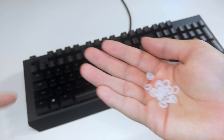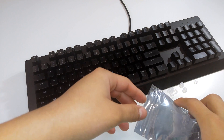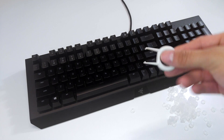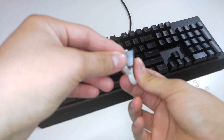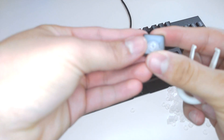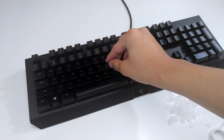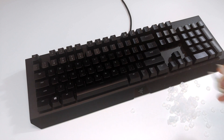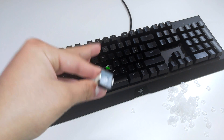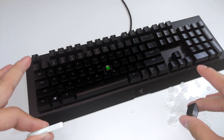These are the clear O-rings — very tiny and easy to work with. Since they're clear, they won't interfere with the RGB lighting, which is perfect. Now we have the key cap puller as well. Using the key cap puller is stupidly simple: just push down and then pull up — that's it. I like to apply the O-rings directly onto the switch stem rather than placing them on the key cap itself, since they can get stuck that way. Then I press the key cap back on a couple of times so it seats properly. Pulling the key cap off again, you can see the O-ring is completely seated and doesn't affect the RGB lighting at all, making the noise more subtle.